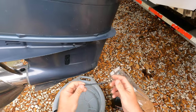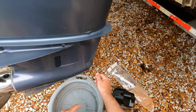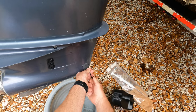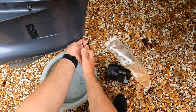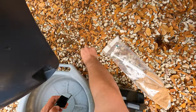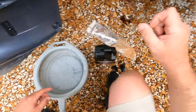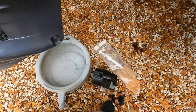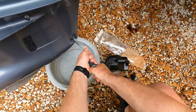The first thing you're gonna need is a 4mm Allen wrench. That's to take this screen off, because the drain plug for this is underneath there. So you're going to pull this all the way off here. Comes all the way up. Next you're going to need a catch can. The first thing you want to do is pull the bottom one before you pull the top one.